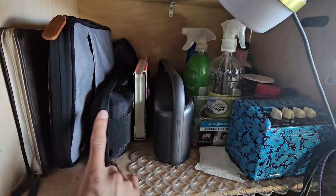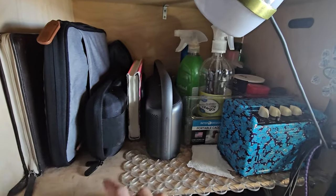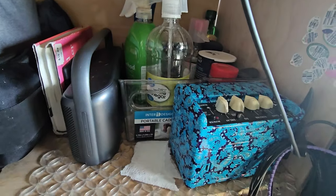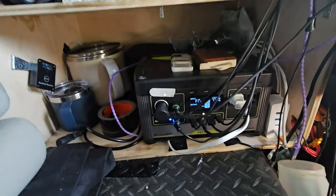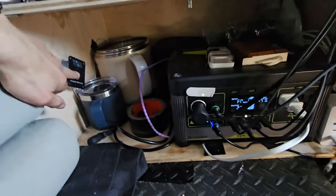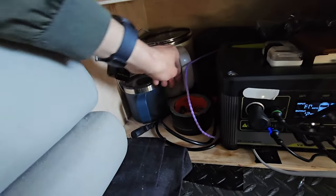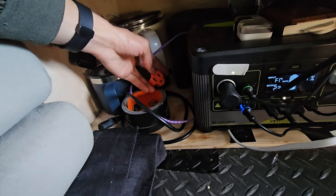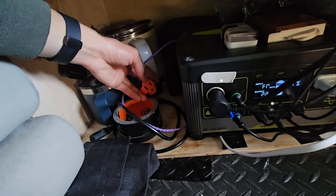Here we have our electronics plus a book: computer, computer, Steam Deck (which I need to sell because I don't ever use it), speaker, Kindle, and a book. Then I have cleaning supplies and cooking supplies. This is a mini amplifier for my electric guitar. On the bottom shelf we have our big power setup. This thing is our inverter remote — we can turn that on. The inverter is installed in the back trunk where the spare tire would be, so I don't have a spare. I took that out and installed a 1500-watt PureSine inverter down there.